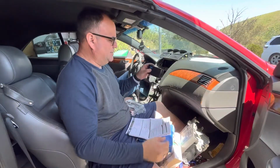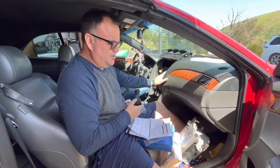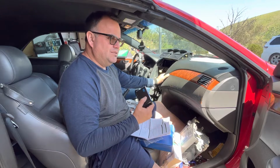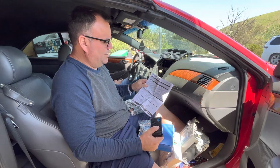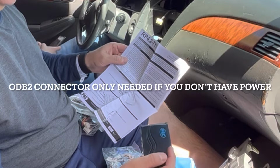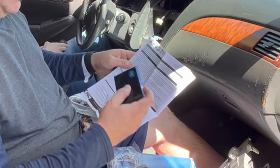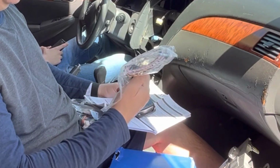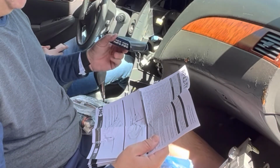So we're going to put a PAC in. The PAC basically allows you to use the original Bose JBL system that's in here, which is the amp on these Toyotas. I had to get one for my Tundra. The one that we specifically got was the RP4.2 TY11, which is intended for Toyota, Lexus, Scion vehicles. And it keeps your steering wheel controls as well as your JBL amp. I also noticed it's got a plug-in for your OBD2, which is like your car's computer. You give feedback, and I'm not sure if my stereo supports it, but we will check it out.